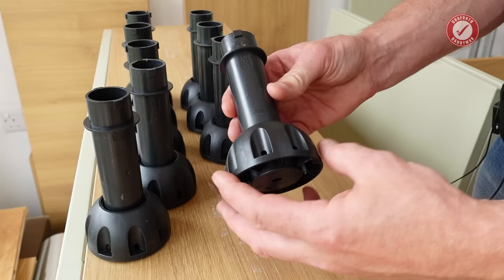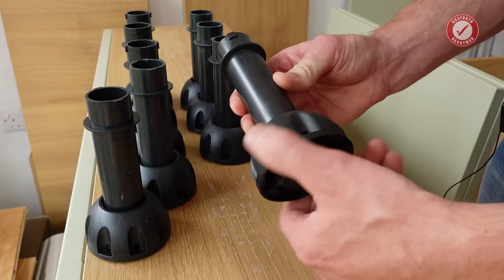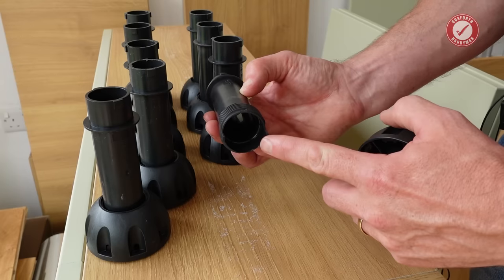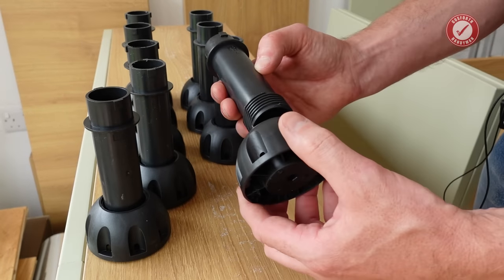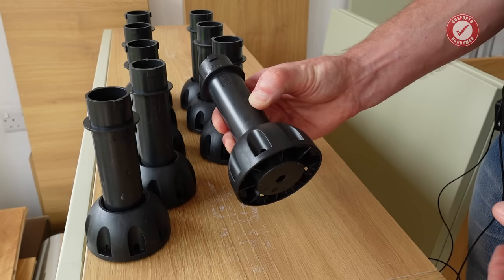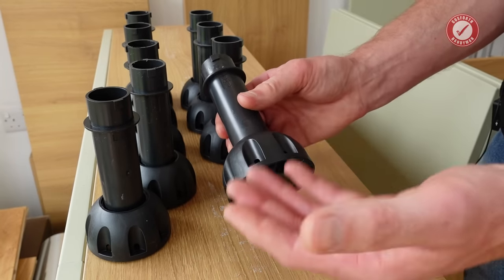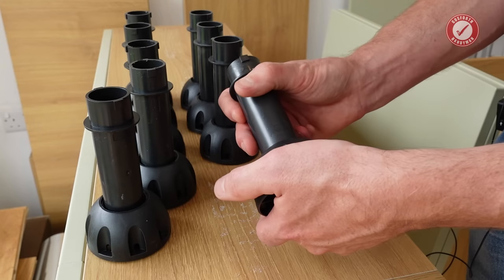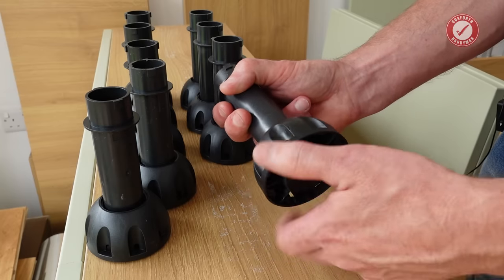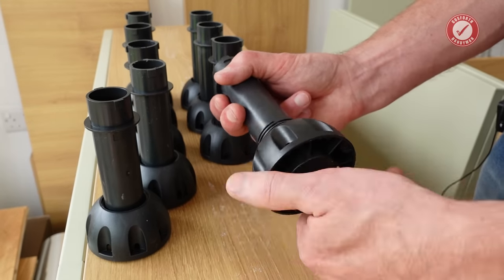These legs are quite nifty, by the way. Basically they've got a little gauge on the side and by default they're set to the mid level. But what you've got on the inside when you take the leg off is these two little pins. As long as those pins are on, when you tighten the leg up gently, it by default goes exactly to the middle position. So as long as your floors are perfectly level that should work for all of your legs. But if you do need to make an adjustment, all you do is give it a firm tighten and that basically breaks those little pins off, then you've got full control to either lower them or heighten them as much as you want.